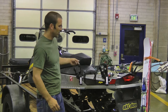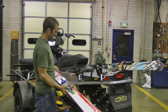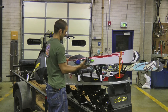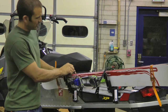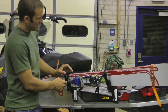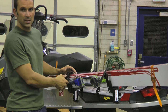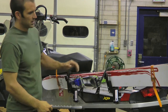Now that the rack system is in place, mounting your skis is very easy. I like to put the tail end of my skis forward, giving your rider more room. Unlatch your ratchet, pick up your skis, and slide them into place. Position your rubber spacer over your skis — this rubber spacer is important because that's what gives the ratcheting system its compression. Without it, your ratchet and bindings can easily get jammed up. With it, you don't need to over-tighten either — just go until it's snug.